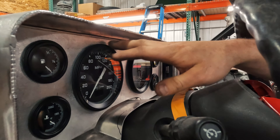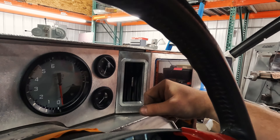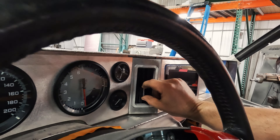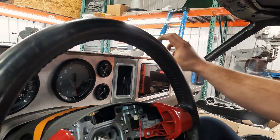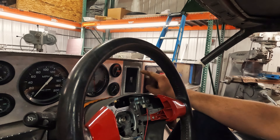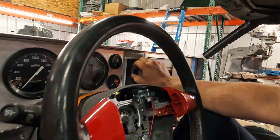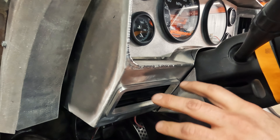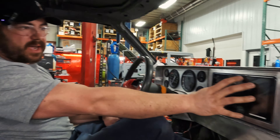We have classic instrument gauges, all mounted in place up here. As we continue further, we have four dash vents — all four mechanisms underneath are from a 2014 Mustang. There were two center dash vents with a cigarette lighter in the center. I cut them apart, machined these custom trim bezels, and mounted the whole assembly. You can also see the other two down here in the corners, so you have four vents: two in the bottom corners and two in the center.